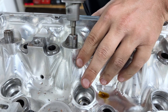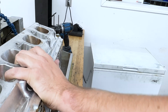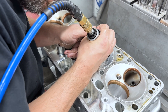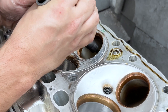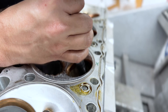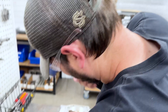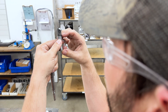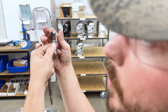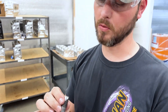Throughout this process we realized that one of the exhaust guides was bent, so we had to replace it and do the same process. We also found a guide that was in the cylinder head that had ballooned out into the port. If I were to try to knock it out without grinding it back, it would have damaged the hole in the head where this needed to press in and have a good fit and be on location.